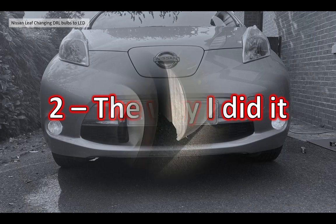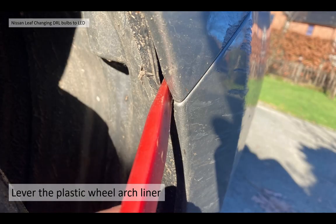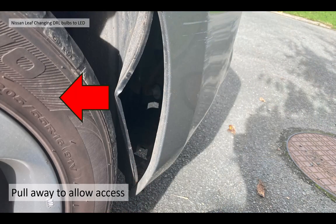So here's the way we actually did it. The access we chose is through the wheel arch - you can get to the back of the bulb, the lamp housing there. You can also get access by removing the lower cover, but that can be quite problematic. We have actually changed the gearbox transfer oil - you'll see that video on our channel - and when you remove the lower engine cover it generally doesn't get removed very often because there's very little servicing on these cars, and lots of the clips, nuts and what have you do break. So I wouldn't advise taking that lower cover off unless you're prepared to make some repairs.